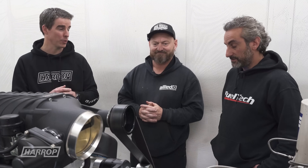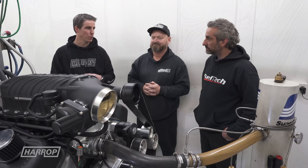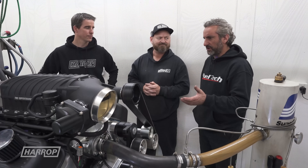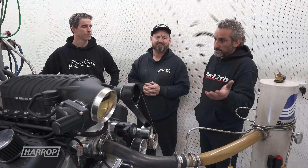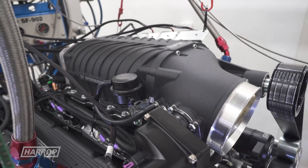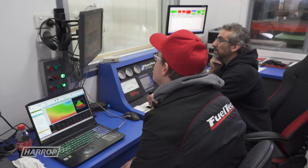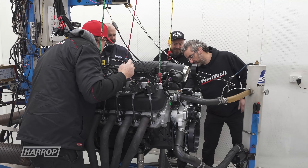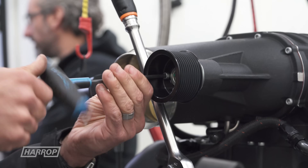A little bit about the combination — and a shout out to SpeedPro, who delivered parts to us at five o'clock; it was the only cam we could actually get. This engine without the supercharger — we didn't have the opportunity to run it naturally aspirated — but with this combination on a 454 with 10 thou oversized pistons, you'd be lucky to make 500 horsepower, maybe 550 if you really went after it. But it's a hydraulic cam, not a roller or mechanical. It runs our drive-by-wire 110 throttle plate, LS-style, and big thanks to Nads from FuelTech for getting everything set up. We started with relatively low boost, but where we're at now we've got the 245 millimeter lower pulley and the 80 millimeter top — a three-to-one ratio — and we saw 20 psi in the end.